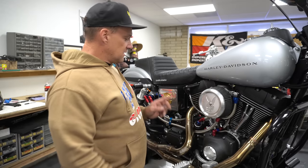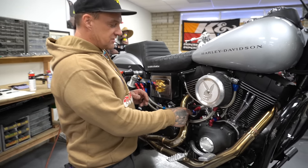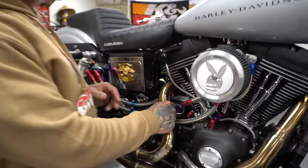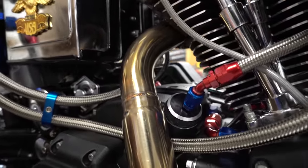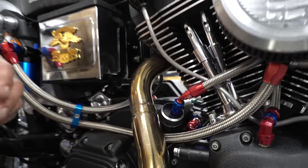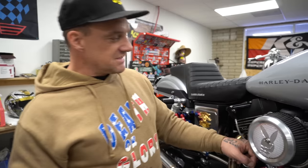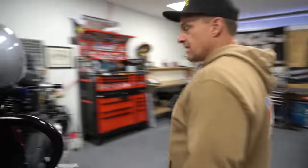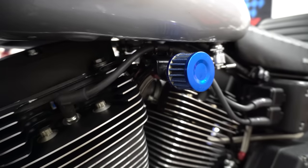But that guy, so now, also to relieve crankcase pressure, I have this one ported quarter inch MPT. The dipstick is gone because I broke it and you can't get dipsticks anymore. So I have to borrow someone's anytime I check my oil. That's really convenient. But before I had a dipstick there and I had the dipstick drilled and all that, too, and it was nice. Broke the dipstick in a different scenario, you know, messing around. But this guy goes up through the heads over to here. And it breathes off of this filter right here. So that relieves pressure in my oil bag.